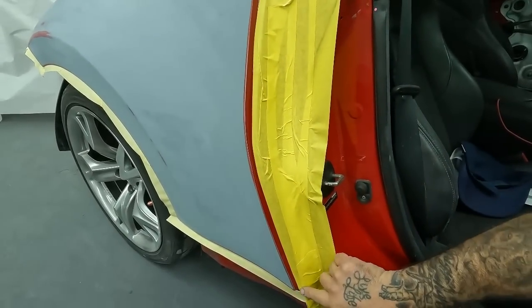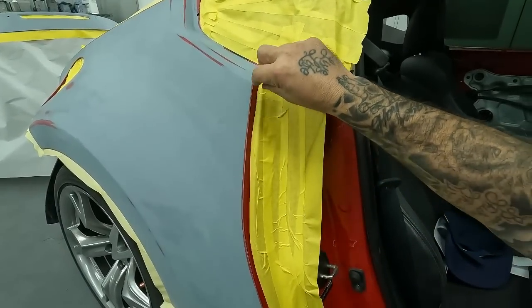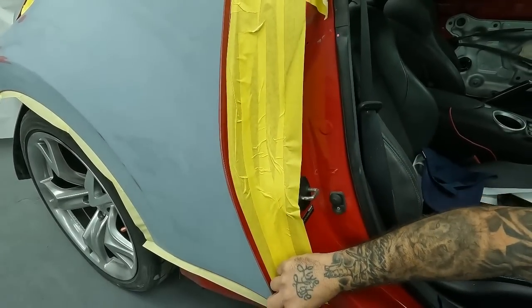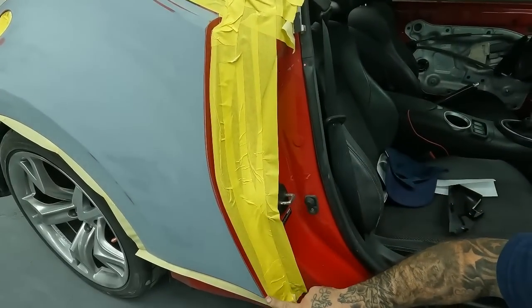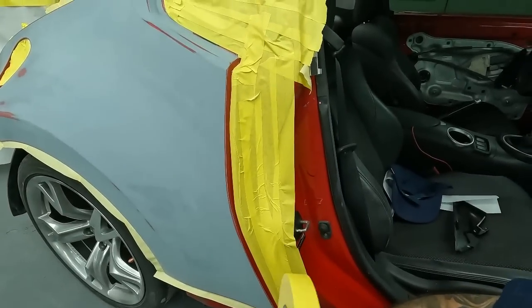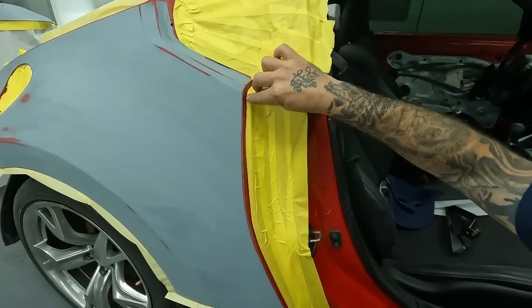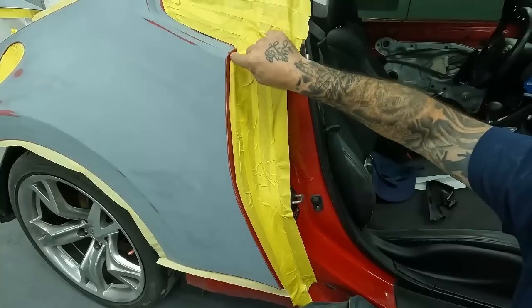So now's where we're gonna do our fold tape. And you guys see I ran a hard line inside the actual valley there with the same amount, exactly perfect, running down. That's in case you do have a problem. You wanna make sure that you run your tape nice and straight and smooth if you did have some overspray where this happened to not work perfectly, which it usually works very good. At least you're gonna have a nice continuous line inside this here where the overspray will stop inside that valley and you'll have a better chance of polishing it out.